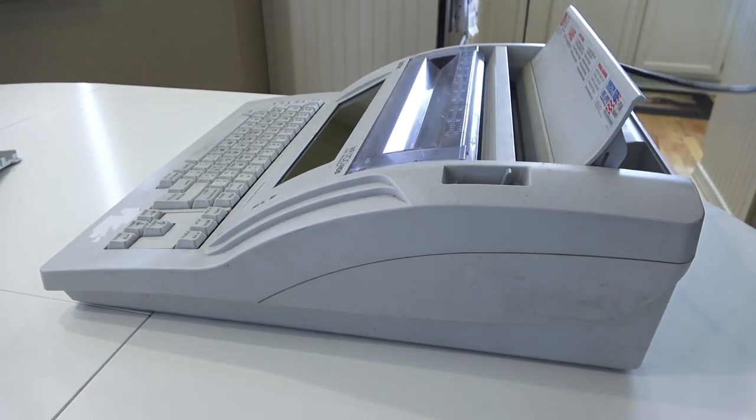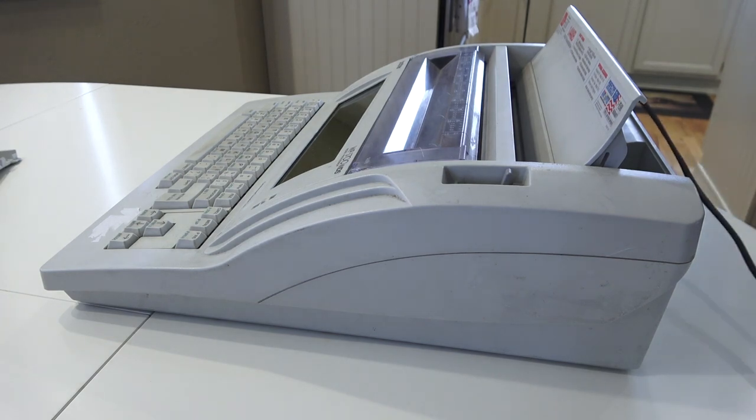These machines did not have any serial ports on them. The Super Power Note series, which were the notebook-style ones, did — at least the ones that were not equipped with a modem. The ones equipped with a modem basically internally utilized the COM port for serial communications, so they forfeited the serial port. That's a bit of a bummer because it would have included a terminal application, and you could use it as a dumb terminal. They also do not have any video output ports — there is absolutely no way to plug in a monitor.